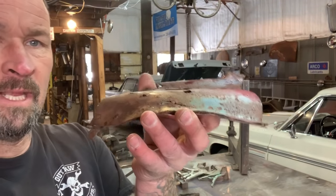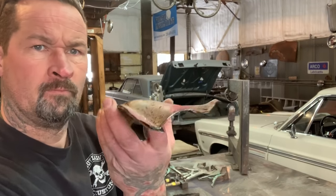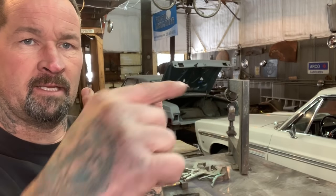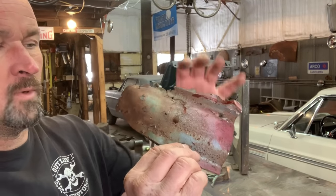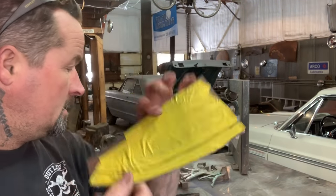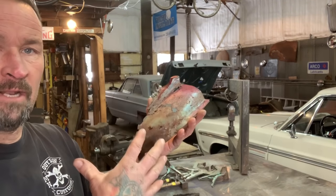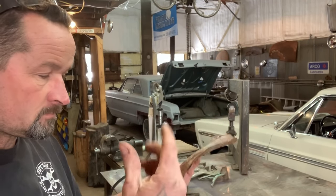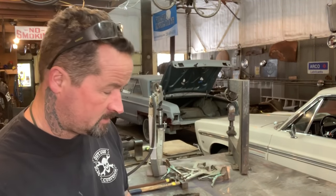What I've got right here is the panel that I'm making. You can see it's got a radius right here, and it's kind of a pain in the neck when you have a radius like this. On a round panel you want to run a flange all the way around. So what I did is I took some tape, laid it on top of the panel, and pretty much copied it. If you don't have the panel you can make a buck or just freehand it. Once you get the hang of it, doing it a couple times, you'll figure it out — it's actually pretty easy.